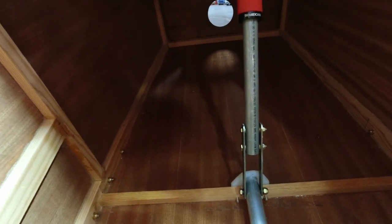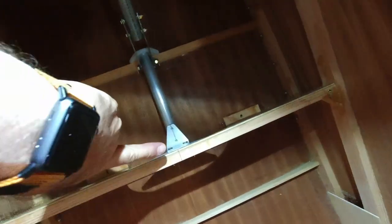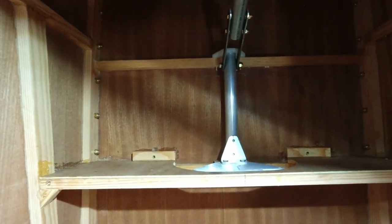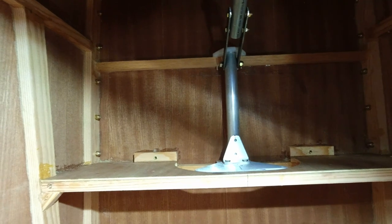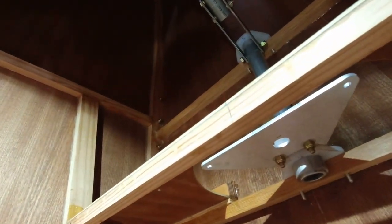Now the other thing I want to do before I do that is I need to make sure that my stick is actually completely centered. So I'll measure off the sidewall here and find its center position, and then I can do that exercise again down there, making sure the yoke center line is aligned with the seat center line, and then I'll kind of clamp it and get a couple holes started. We'll take it to the drill press to finish those, but we'll get them started there anyway, and that'll give me a good way to match everything up and get everything aligned and drilled. And then we have to come in here and we'll figure out how we're going to drill these two for the collar.